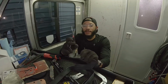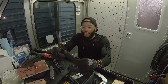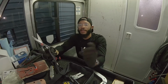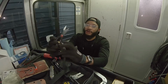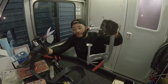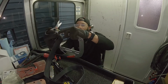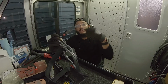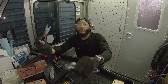This is what I want. I want to keep this. I want to be able to use this to apply pressure to the oil cooler. So I'm just going to salvage this off of the tube. And I plan on using a socket and then stick it over like so. In my head, it makes sense. This is a valve spring compressor. I'm going to use this to apply pressure. And then the inner tube itself should hopefully seal around the hole, so it doesn't allow air to escape.